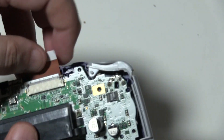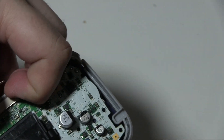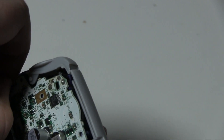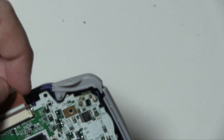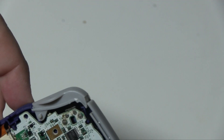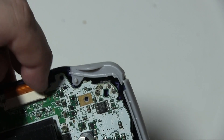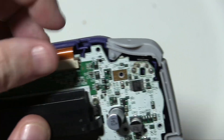For the display, we've got this little brown bit on top of the holder — we need to pull that towards the cable, so upwards. We need to pull that out. So that's slightly raised, and now we can slot the ribbon cable in there like that. Now we can push this back down again. You'll see that these are now flush with the top and it's now fully in.